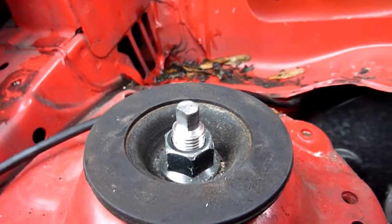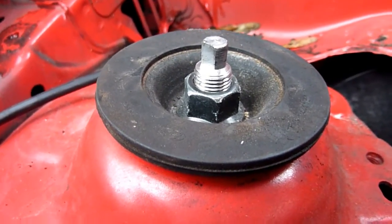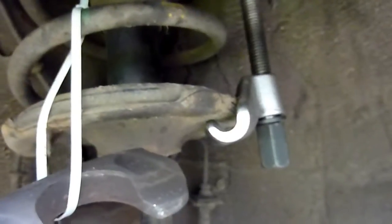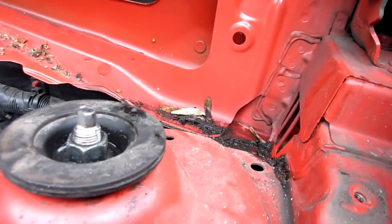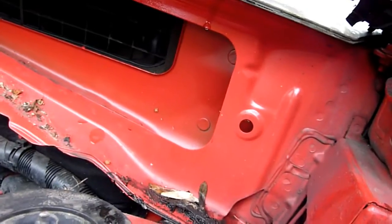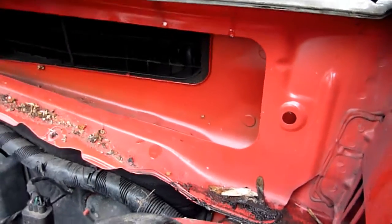Driver's side for reference - it's about four and a half turns. Plan is to put a pair of spring compressors, one there, one there, compress the spring. There are two nuts - one top, I think one below - that's the main one. Should make it safe enough to turn when there's little resistance - the top one should turn without turning the bottom.